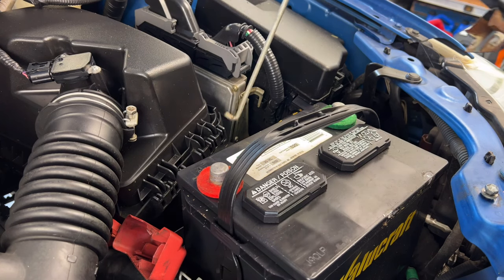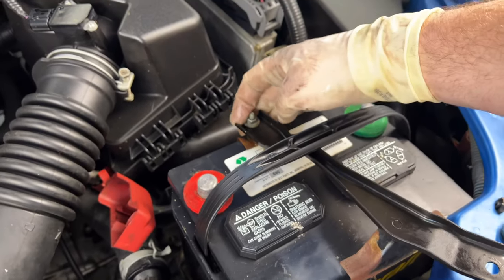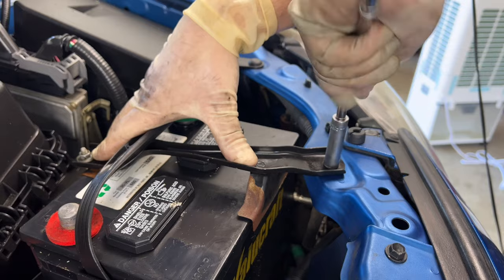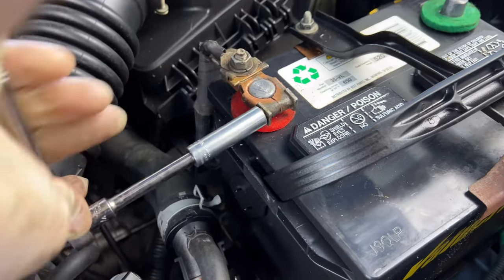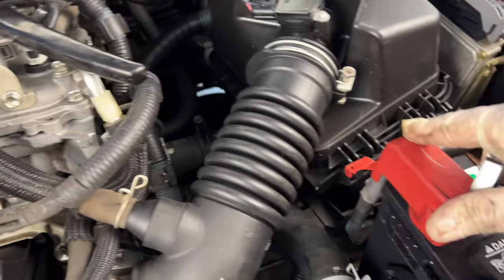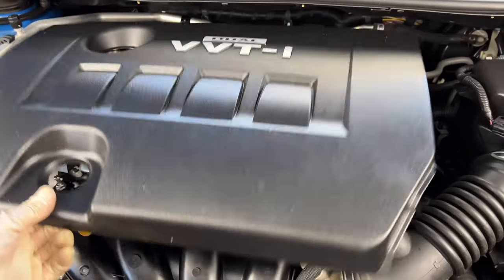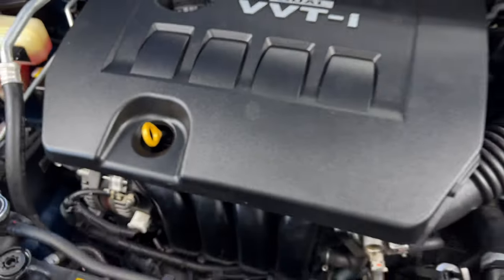Reinstall the alternator plug and don't forget to tighten up the drain screw so all the new fluid doesn't drain out. Reinstall the battery — the bracket just goes right into a little slot down there and hooks on. Hold pressure while you hold the bracket in place so you can get the 10 millimeter bolt onto the front part of the frame and tighten it down. Reinstall the positive cable first with the 10 millimeter, then add the red protective cap, then reconnect the negative cable. Finally, put the engine cover back on by lining up the oil cap and pressing down.